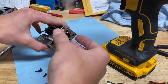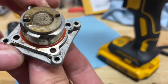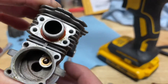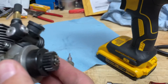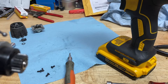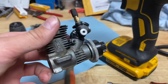Next thing just slides off — the o-ring looks good, but could use some cleaning. My crank is also a bit rusty which is not good, though the engine turns over easily. There's not much marking on the piston; in fact the crankcase is extraordinarily clean right now, so that's a good sign.